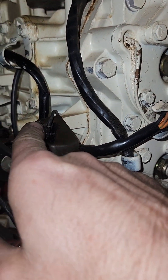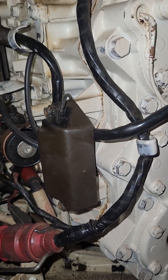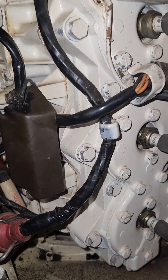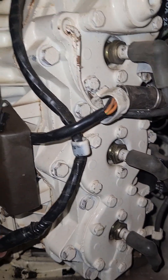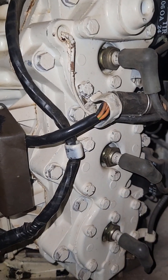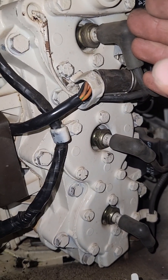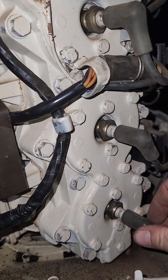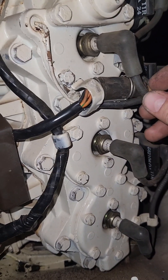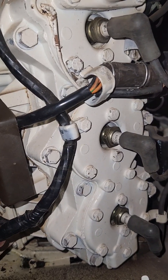Make sure you have a good ground on this wire right here, because that's where it actually gets ground — they're grounded through the mounting screw. With the engine running and the key off, pull a spark plug cap to see if it changes the sound of the idle. If it does, you're on the right side. The next thing I did was kill the motor, pull all three spark plug caps off on this side, and crank the motor. It's not great for it — don't do it long — but for a few seconds to run the test. Give it some fuel, crank it up, then turn the key back off and see if it kills it. If it does, that's the side your problem is on.